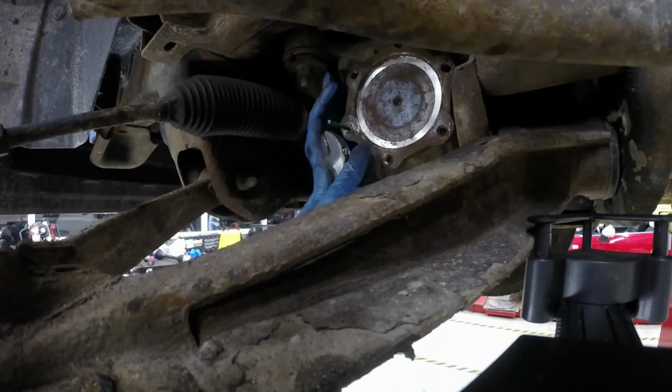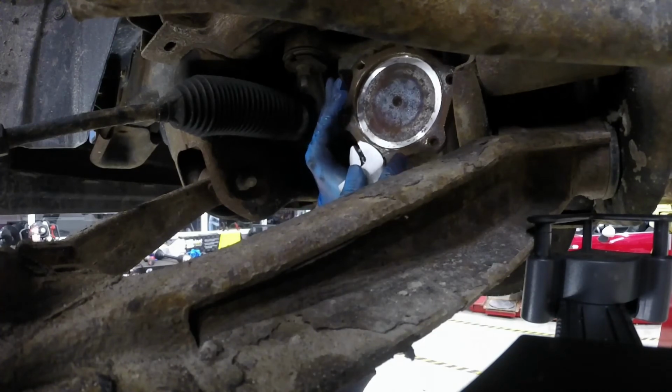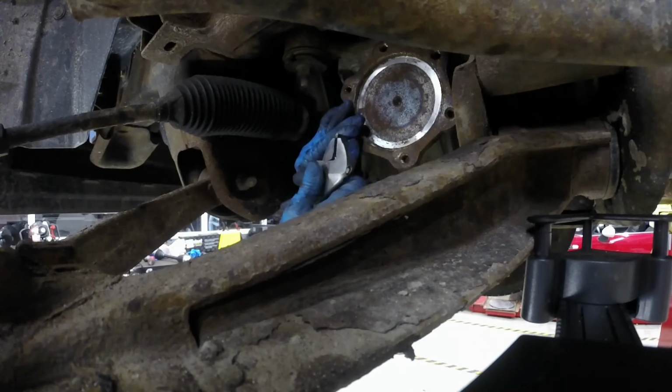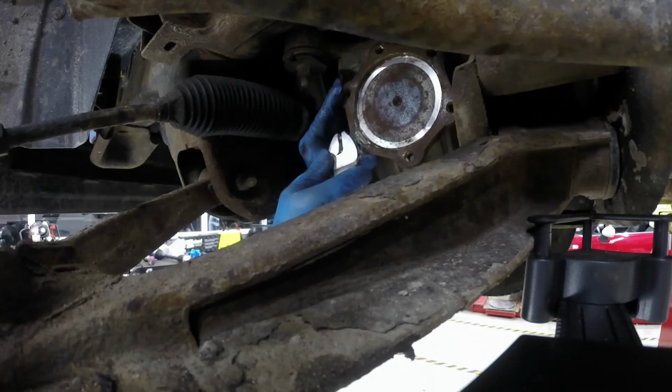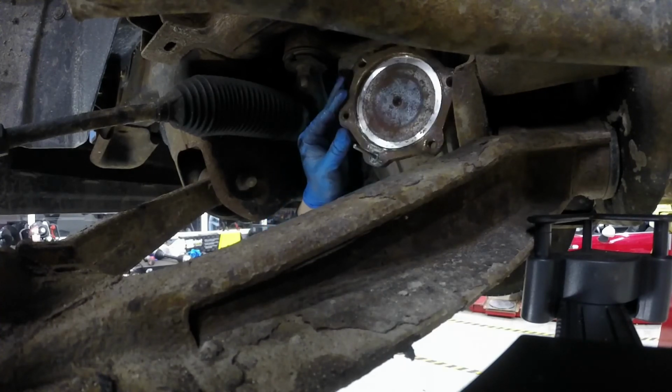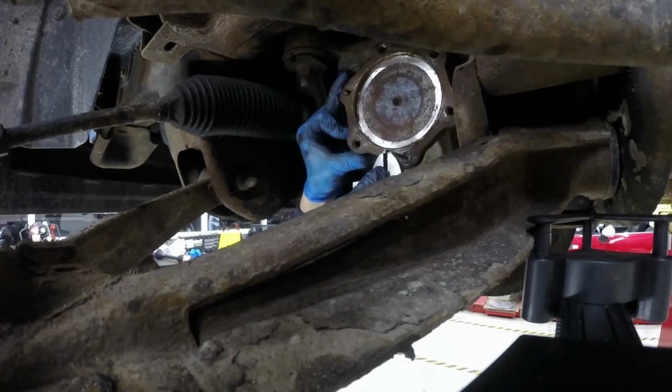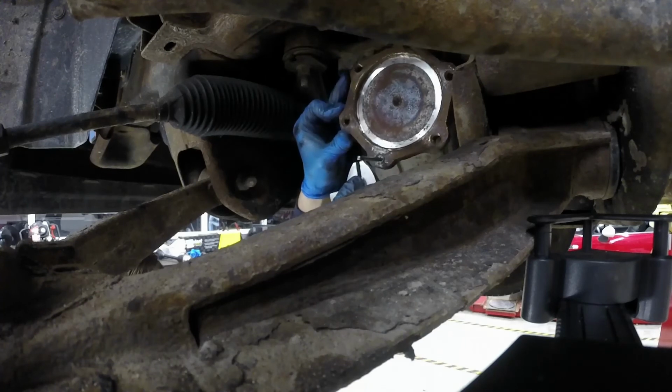And the screw extractor is spiraled on the end, so as I turn it to the left, it's going to cut into my bolt. And as I turn it to the left, I'm also loosening the bolt out of its hole. So you can see I just cracked it loose, and at this point I can work that bolt out.